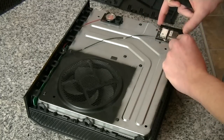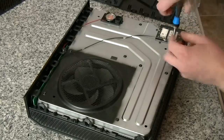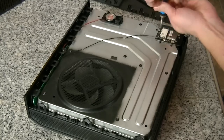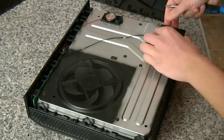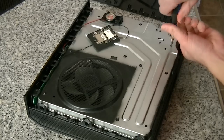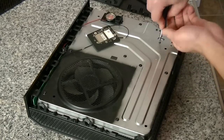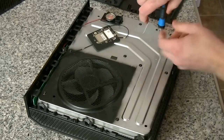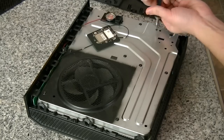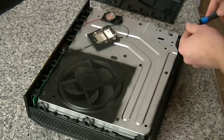We're going to take off — I think this is the wireless card for the Xbox One. Take two screws off, this thing will pull straight off, put that off to the side. I've got another four small screws right there. These four screws actually just hold on a kind of extension for the mounting bracket for this wireless card. I find it's easiest to take them off anyway.